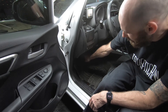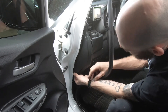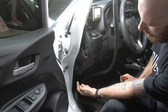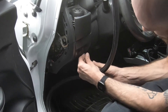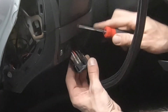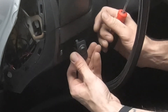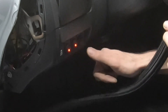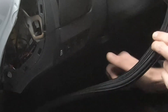After running the cable through the firewall, pop off the rubber trim and remove the side panel. I ran the switch cable up through here and took out one of the factory switches I was not using. Wired it like so: black on top, red in the middle, white on the bottom. This isn't the switch the light bar came with — I had some other switches laying around and wanted them all to look the same. You can mount your switch wherever you want to, but this is just where I mounted mine.